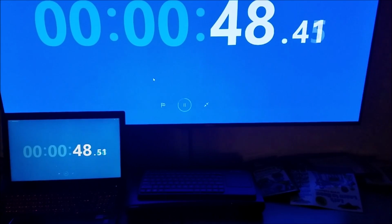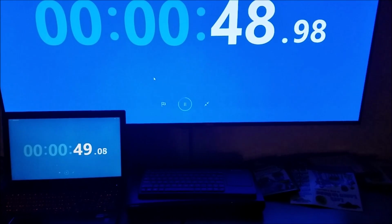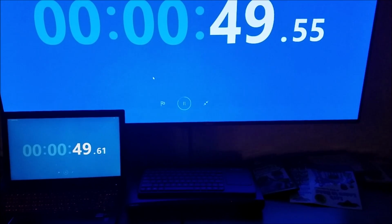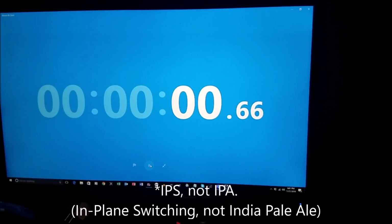As I was going over this video and pausing it, I found that with my laptop screen, it took about 28.7 milliseconds for a number to fade completely away. On my IPS monitor that I have hooked up to my gaming computer, it was about 33.7 milliseconds for a number to fade away. But on the OLED television, it was 5 milliseconds, if that. There are certain times I could pause it and see 2 numbers at once on the OLED television, but that was just for 1 frame.